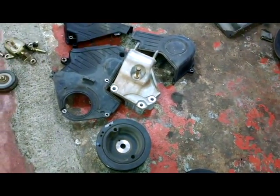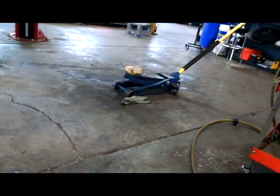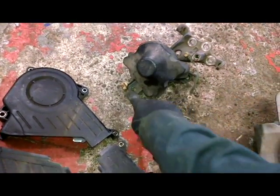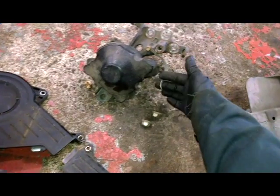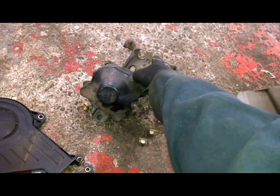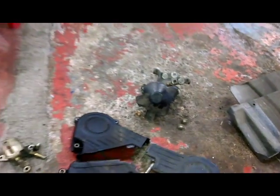All right, I'll show you some more stuff following, but I took the crankshaft pulley off. And I got a jack to support the engine. Took this off. 14mm bolts hold this part on here on the frame. 10mm bolt for the ground. I think they were a 17mm bolt in the middle, and then two nuts. You take this out and you'll have the engine supported.